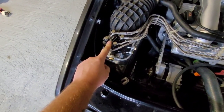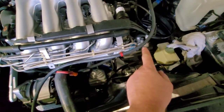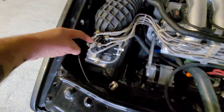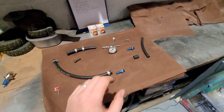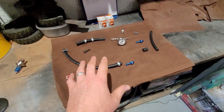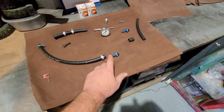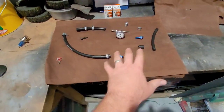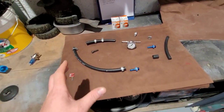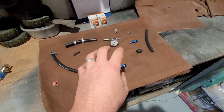The idea is this union is where you want to test fuel — that's the one which comes out and goes down to your warm-up regulator. All we want to do is interfere with this gap here with a pressure kit. I spent many hours over many months trying to research and find the best bit of kit. About 90 quid delivered is the cheapest you'll get, but that's still awkward because it has banjo fittings rather than threaded fittings, meaning you'd have to take too much apart. This keeps things simple.